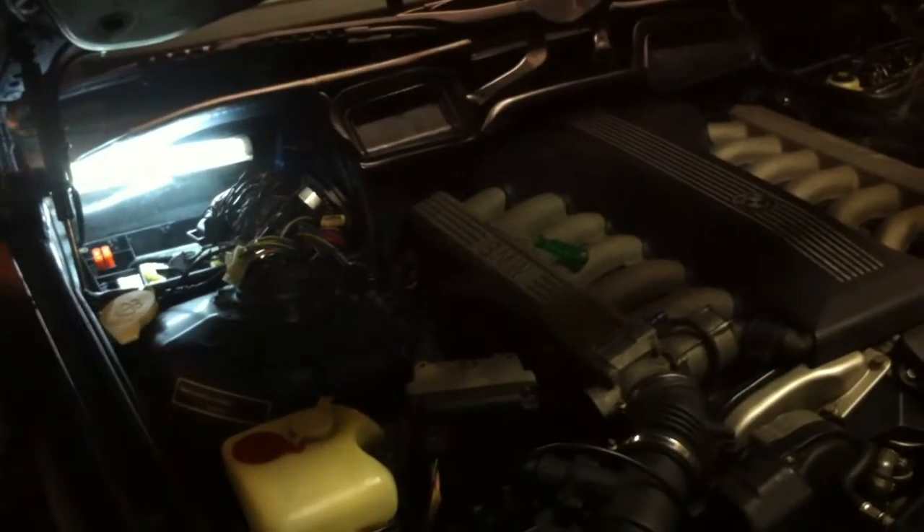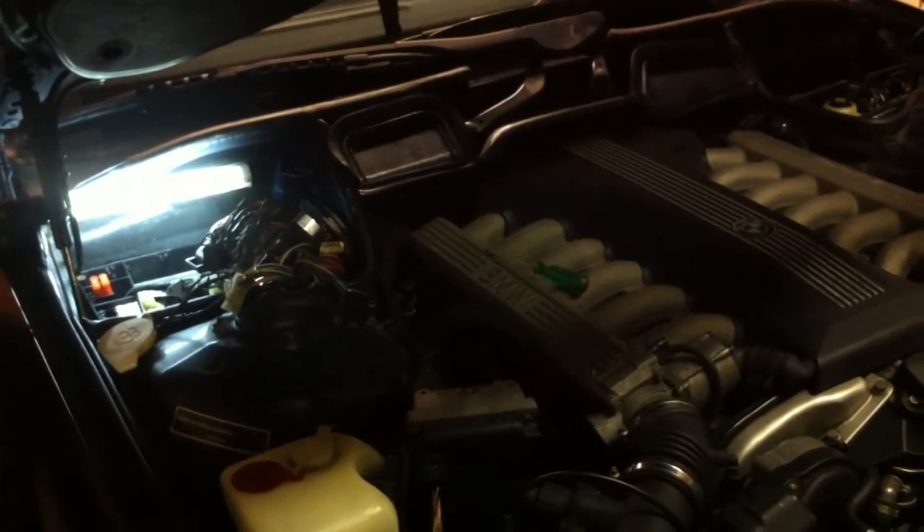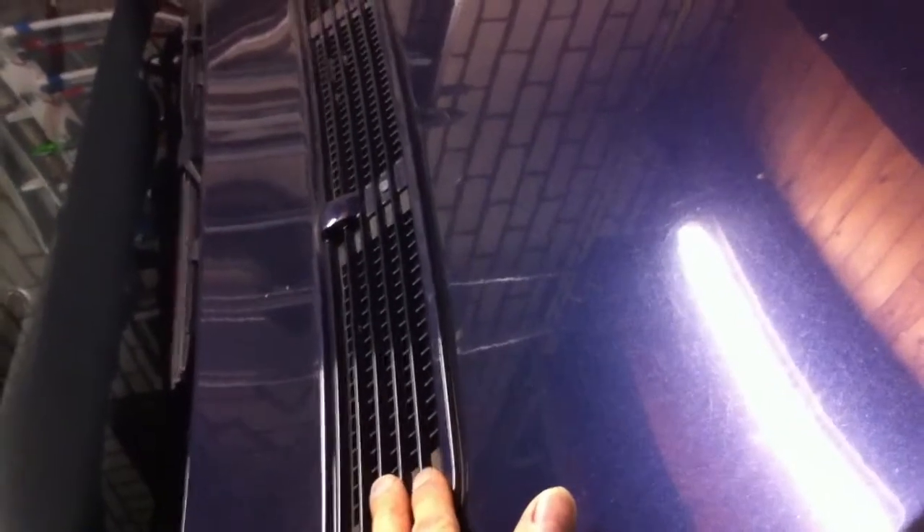Here I'm going to show the wet area in the E-box of this BMW E38. On top of the hood we have the air intake for the interior ventilation, and it also takes rainwater. This rainwater goes to this hole, and there's another pipe that goes to the engine bay. This hole is dripping, releasing water on top of the E-box. And of course normally there is a black lid on top, but it's still getting wet — it's always soaked.